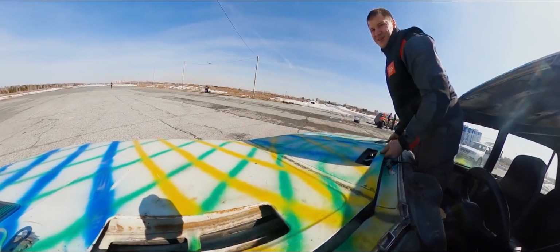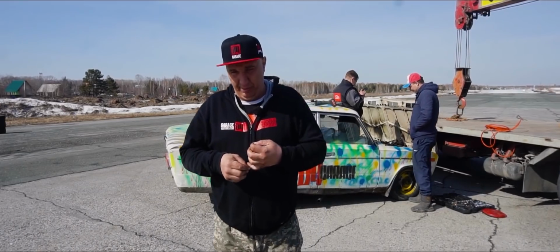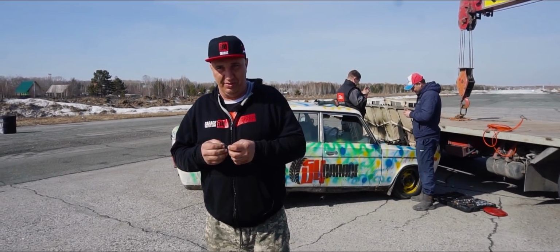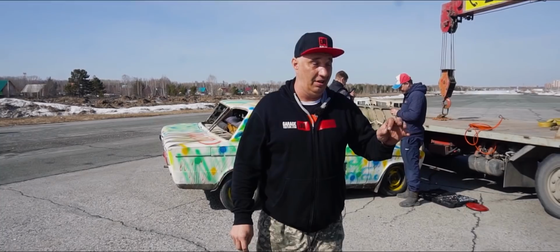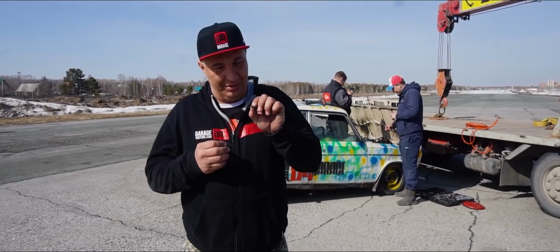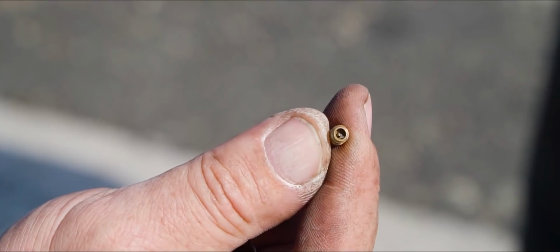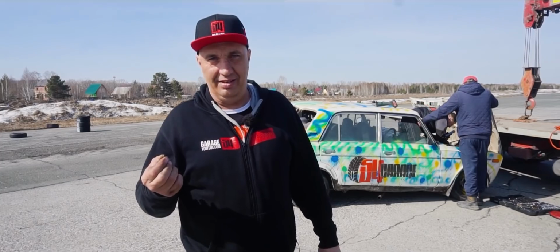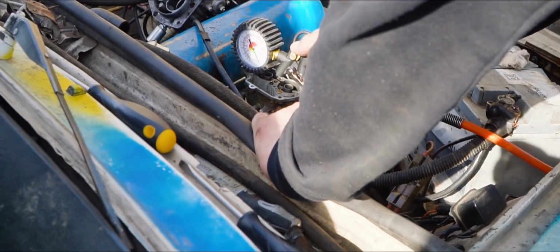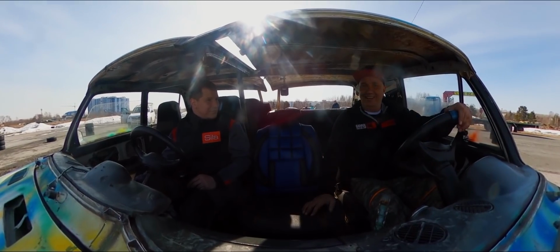We need to do a few more adjustments. And we found the problem, fellas. We did have to fiddle with at least one motor, though back at our base the carby was working perfectly. So we're actually running different carbs on either engine. And now here's the situation. We removed this here jet, and you see that's the problem with these particular carbs. If something happens to find its way in there, the engine's not going to be able to run. And we fixed it. Everything seems to work.